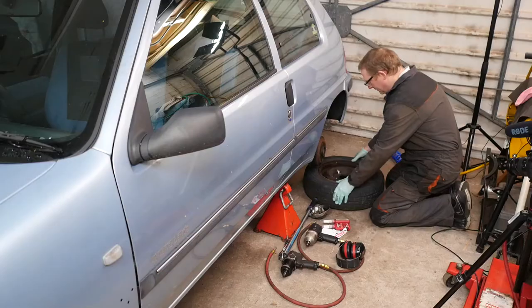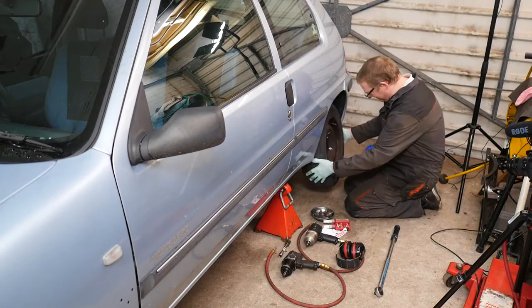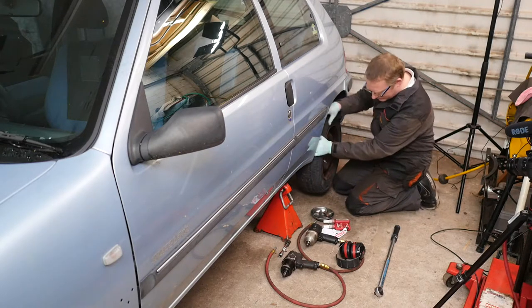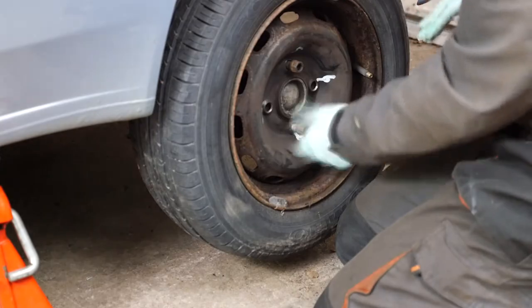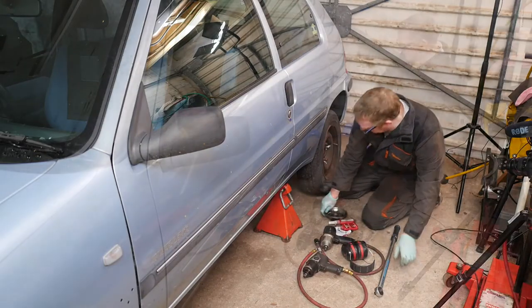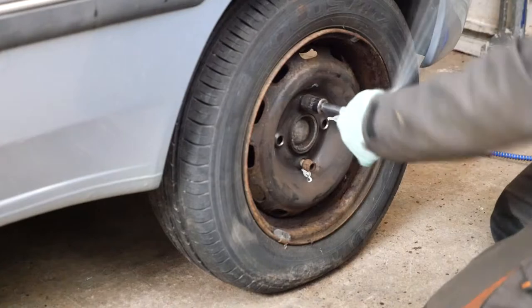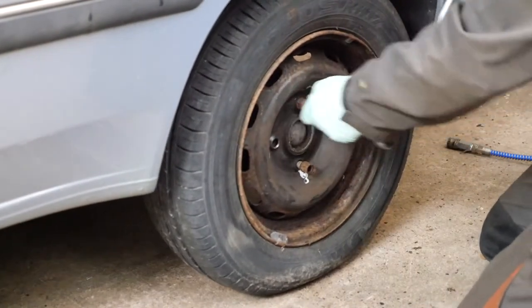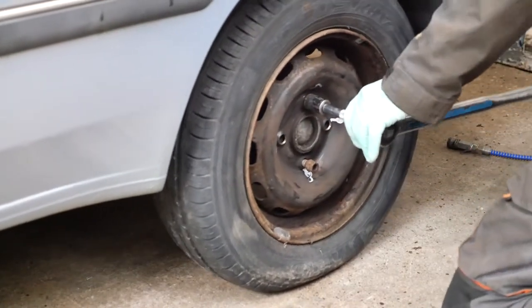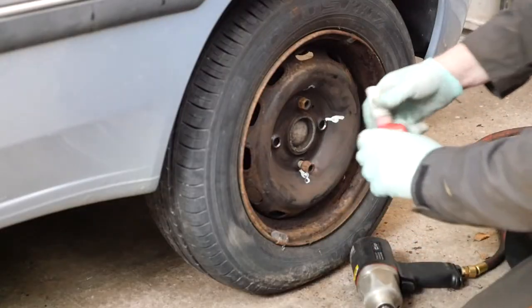Now onto the rear wheel and the last four bolts, which will all be over-torqued — we'll tighten these as much as we can before they fail. Bolt number five: we're going to use a torque wrench and give this 170 newton meters. I know that near 200 newton meters these bolts fail, so I checked that on the other side. So 170 is near the stripping point of the thread.